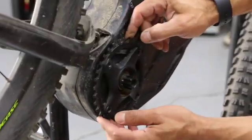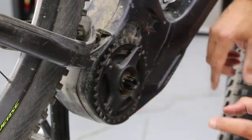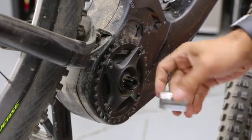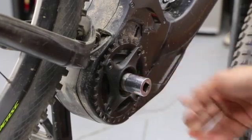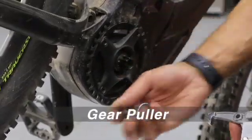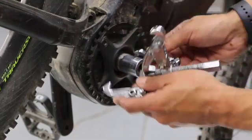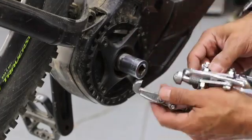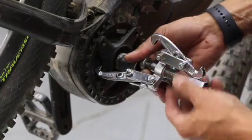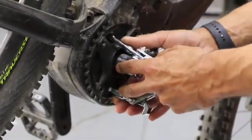The chain ring is still pressed on, so it needs a puller — grab it from the outside, push off the center, and extract it. A 13/16th socket works; you can go slightly larger and it'll probably hit a spacer without hurting anything. The three fingers of the puller fit on the inside, and the center piece drives into the shaft. The socket protects the threads we'll need to put the crank arm back on.